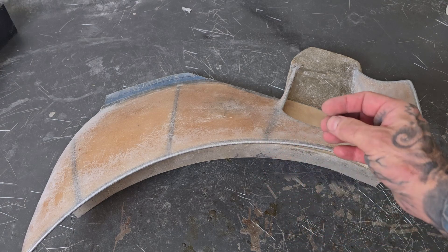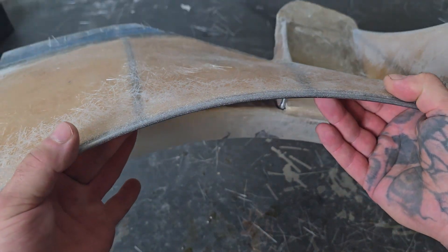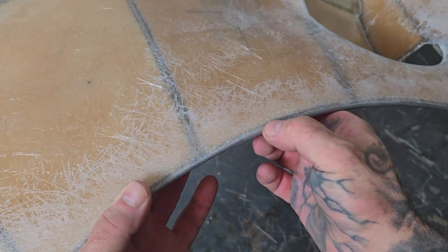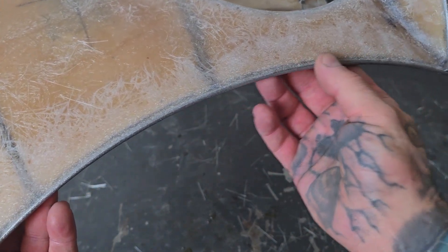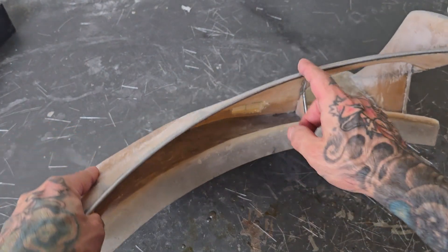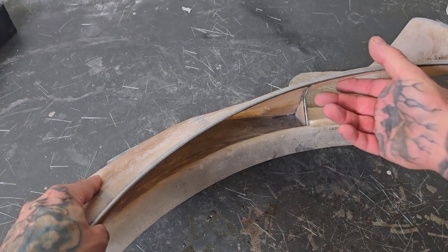So again, when I do it, talking about encasing — what I'm trying to do — you can visually see that my fiberglass and my metal has a really, really good bond. You can see right here on this edge, it's really hard to tell where the fiberglass ends and where the metal starts. And that's really what I want to see, because when I have this transition point right here, I can see there's no pin holes, nothing in the way of impurities or something that I would feel would cause this to delaminate. And when I lay up the inside of the panel, I will feather this edge back like I have done on the top side so I can come back with additional fiberglass and wrap around to fully encase all this round rod.